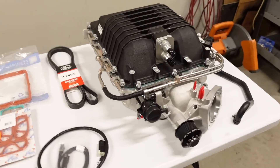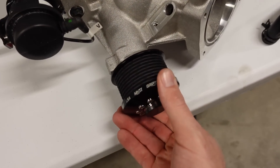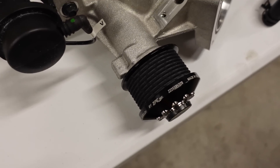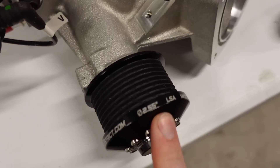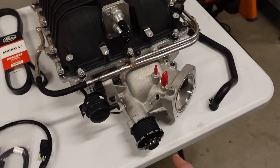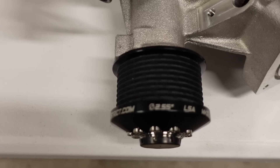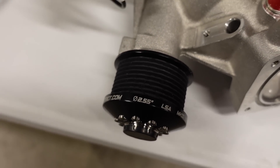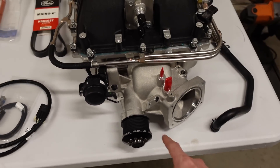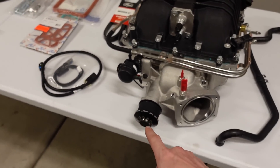In terms of changes made to the supercharger, this is all brand new, but they press off the stock pulley and install an aftermarket one. This is a Grip Tech pulley, which helps prevent belt slip. It's a 2.55-inch upper, though I'm not sure exactly what boost level it will put out with the truck balancer. I'm probably going to try to upgrade to a 2.45 or 2.38 because we want as much power as possible and the motor is built to accept pretty much anything we can throw at it.